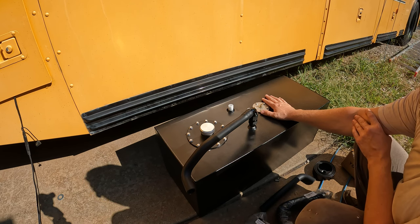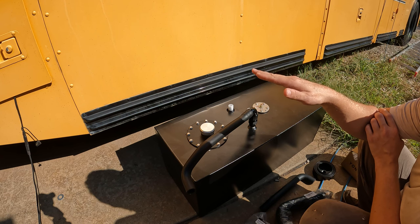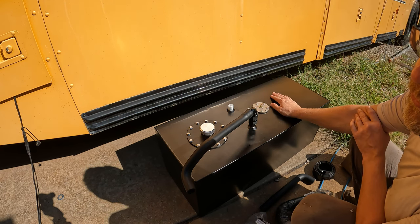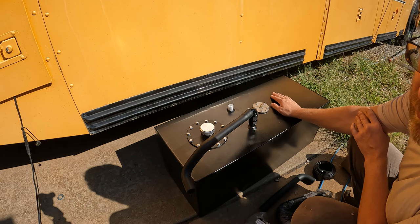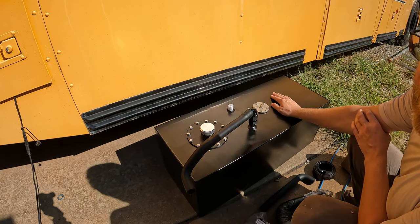and I thought about doing that, but the thing I don't like about it, if I was going to tap the main tank, I'd want to make sure that I left my pickup high enough up from the bottom that it wasn't possible to draw the tank dry, just so I don't have to pay a whole lot of attention to it. That said, that then means that if for some reason my overall volume gets down below about 10 gallons, I wouldn't be able to heat the bus. And I don't love that.